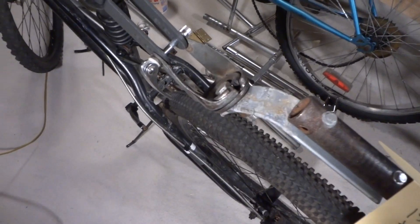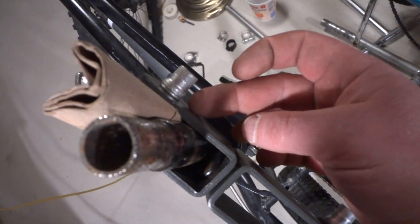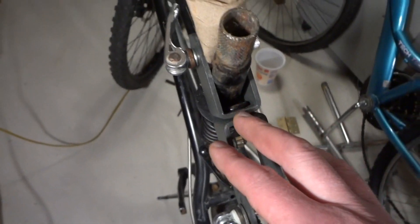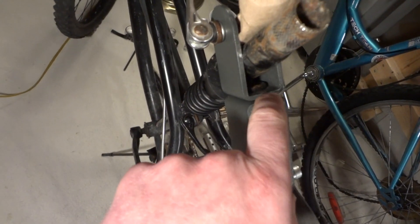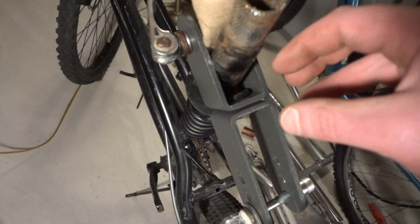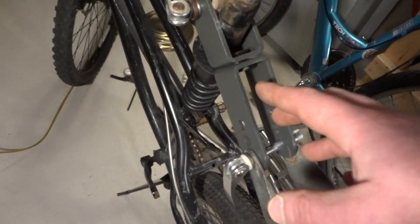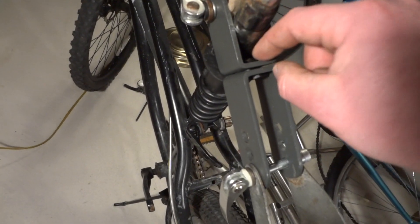What you can do — this is just a mock-up — is drill this hole as close to your seat post as possible so there's minimal play. You can build something like this: it's from a weightlifting set, used for bicep curls — a universal joint with a bolt in it. You can make your own from heavy-duty bent steel or a square bar cut to fit around your seat post, giving you rotation when turning left and right. The bolt handles the roll axis.